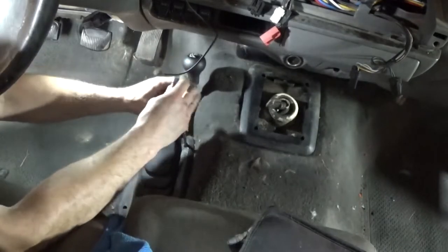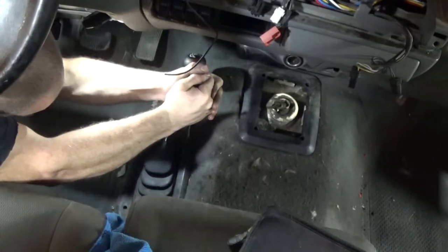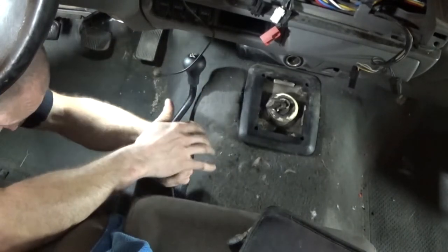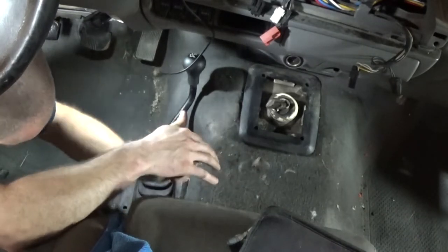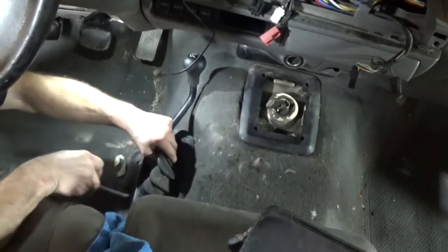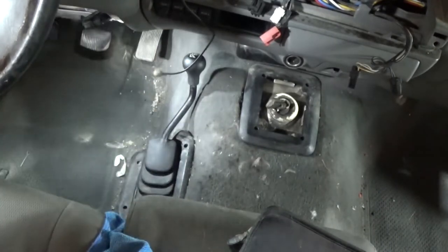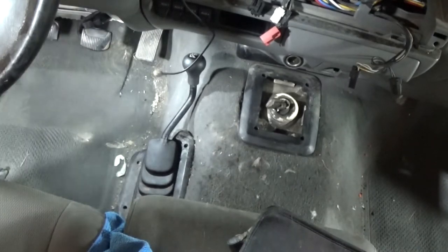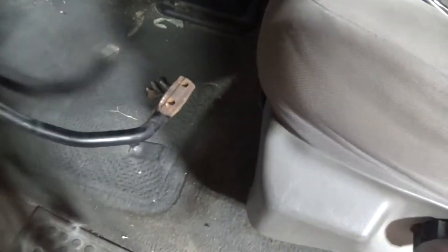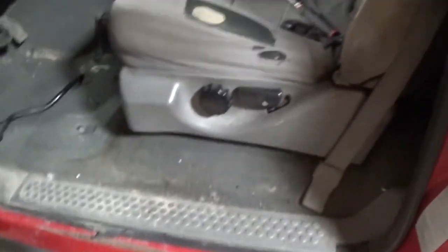The transfer case shifter is usually Phillips screws, if I can get to them. There's so much junk that gets into these things. The newer ones just clip in. I may have to pop the boot out. I'm going to have to go from underneath. I'm pretty sure it's two 10mm bolts — I'll find out. I've got the transfer case shifter loose from underneath. You can get to the two 10mm bolts with a ratchet wrench or regular wrenches together — break it loose, then use the ratchet wrench. I'll show you more when I get it up.